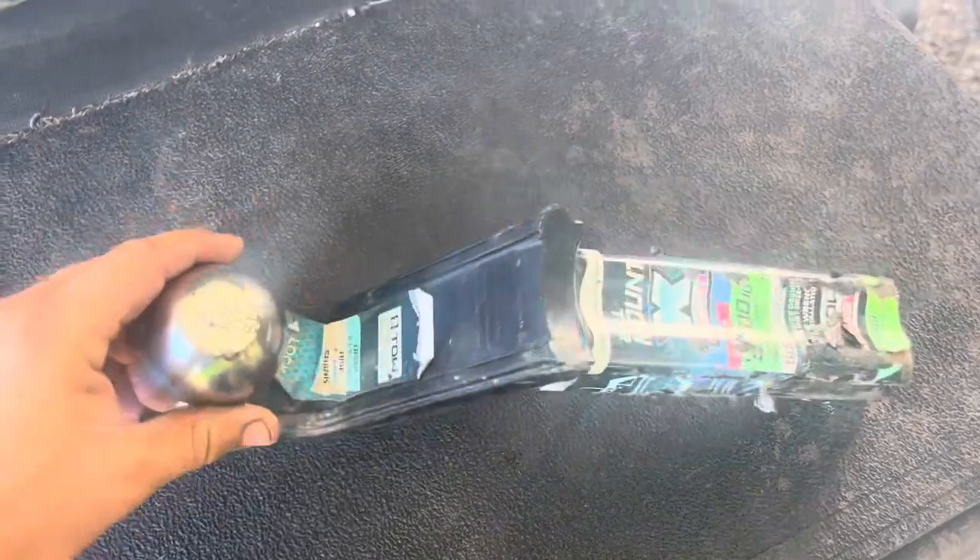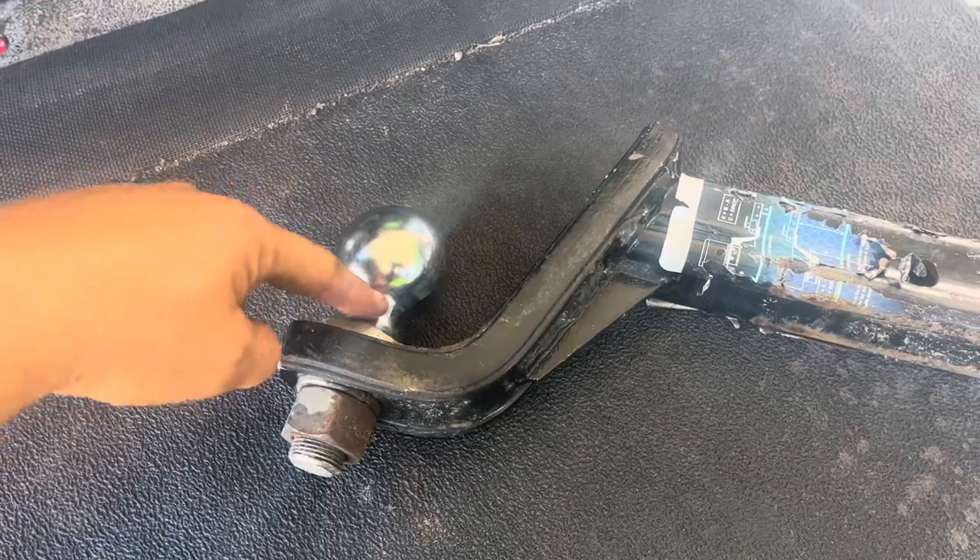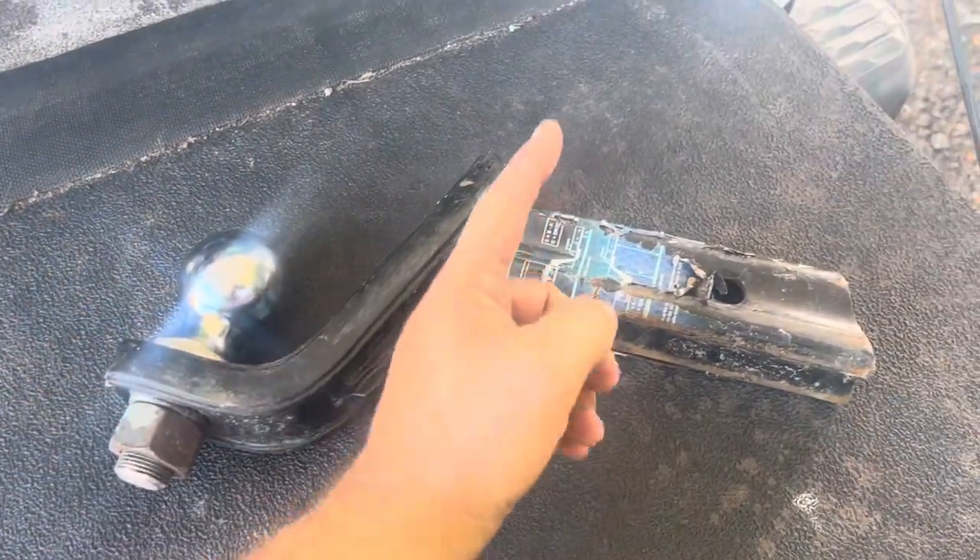I've been doing recovery work for about 15 years. I've seen one ball snap off and probably 20 shafts broken — just in the work that I'm doing. People have seen hitches fail, and a man died a couple weeks ago from a failing hitch. It happens all the time because it's the wrong design. This is meant to hold a trailer that is rolling with no resistance — that's what a trailer ball is for. It is not a recovery piece of equipment.